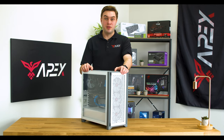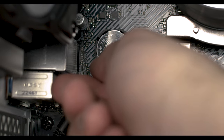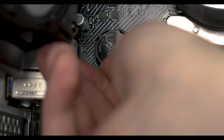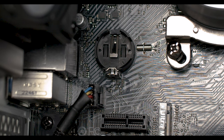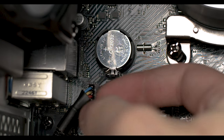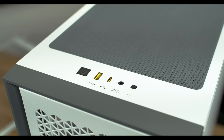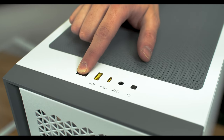If you don't see the clear CMOS pins on the motherboard, don't worry — this final option should get the job done for sure. Locate the CMOS battery, which looks like a quarter and is embedded in your motherboard. Then push the clip to release it. Make sure to take out the CMOS battery and leave it out for about 1 to 5 minutes before reinserting it. If you don't see a CMOS battery, it may be located under your dedicated graphics card. Then you're free to close up your PC and restart your system.